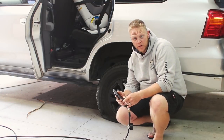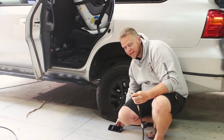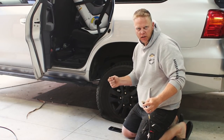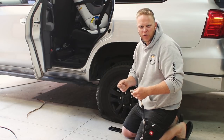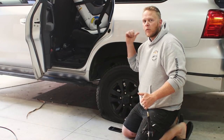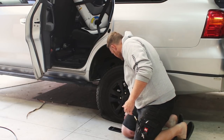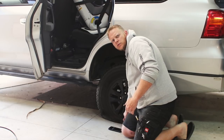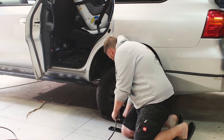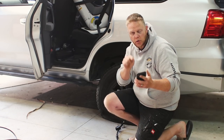I think this looks as bare as possible. Stopwatch ready. This is the stock standard test — the tire's completely flat. I'm going to go for a minute 30 and then check the pressure. That's how I'm going to do it, because otherwise taking it on and off won't be fair. The car's running because obviously power still needs to get to the front, and I'll have the compressor wiring running to the back. Let's put that core back in, then turn the compressor on and start the stopwatch.